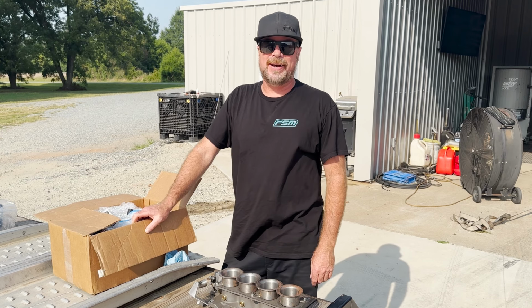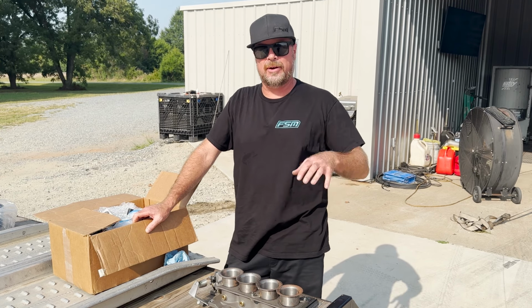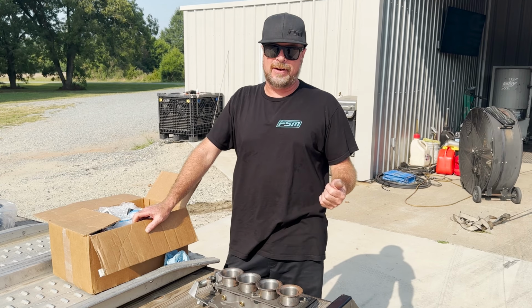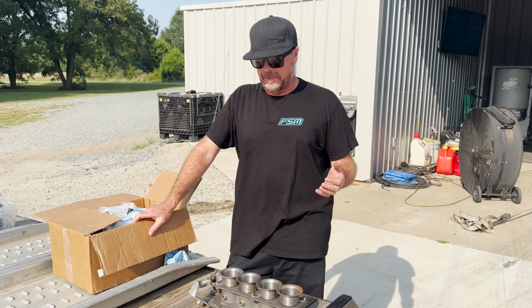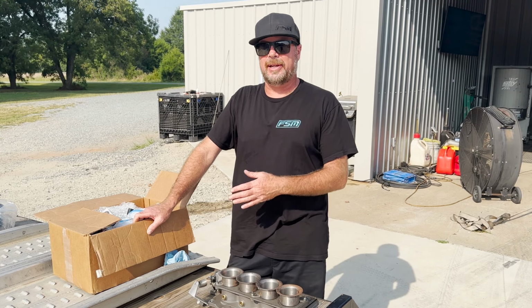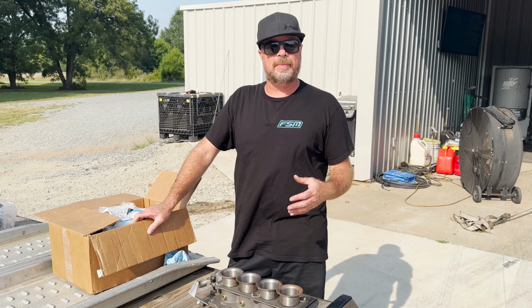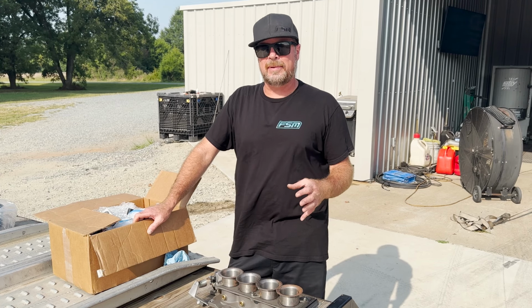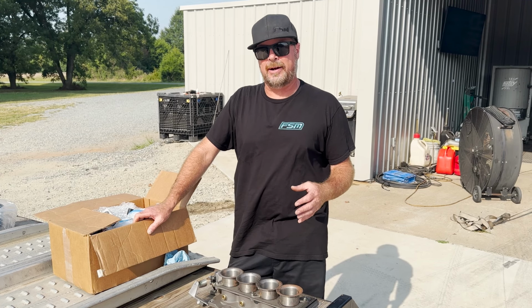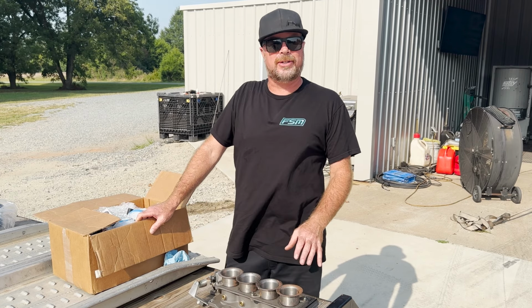That was cool. We made a dyno pull this morning. It made like 921 with the air filter on. Pulled the air filter off, it just made 950, which is great. 950 is not where I want to be, but the engine is repeating. And we now know that air filter will eat up about half a pound of boost and probably about 20 horsepower, somewhere in that area. So I'm calling that a restriction.